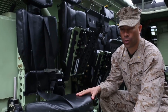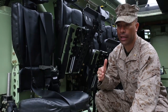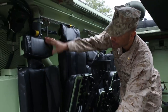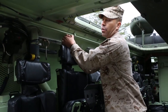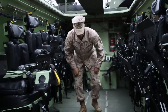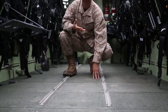This seat, in an actual event, strokes anywhere from zero to up to four inches. What that does is it increases that ability to survive and be able to walk away without those lower extremity injuries. To include also a headrest. The unique thing about these seats is they actually serve as a secondary function — the backs of the seats can be stepped on to maneuver on top of the vehicle. Walking on the inside of the vehicle, you also have a new deck floor that's about eight inches up from the bottom of the hull, which also gets the occupants away from the actual blast event.